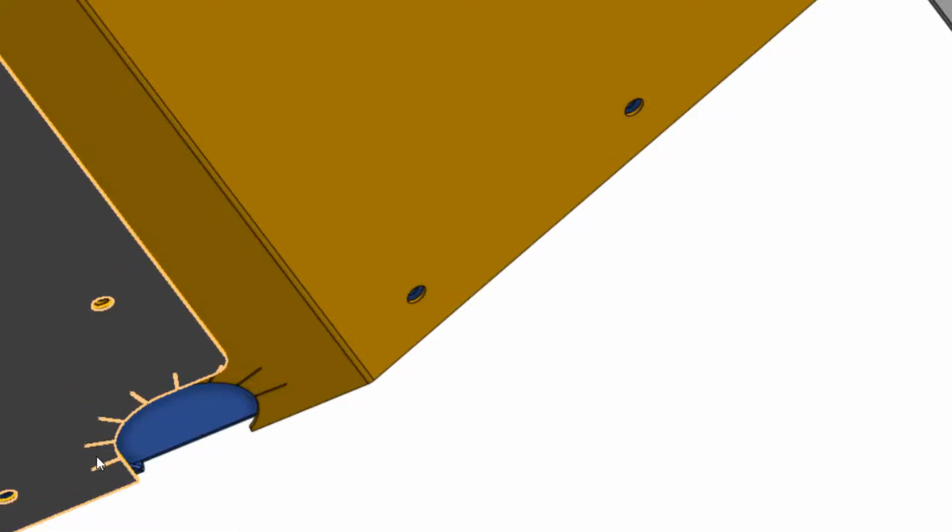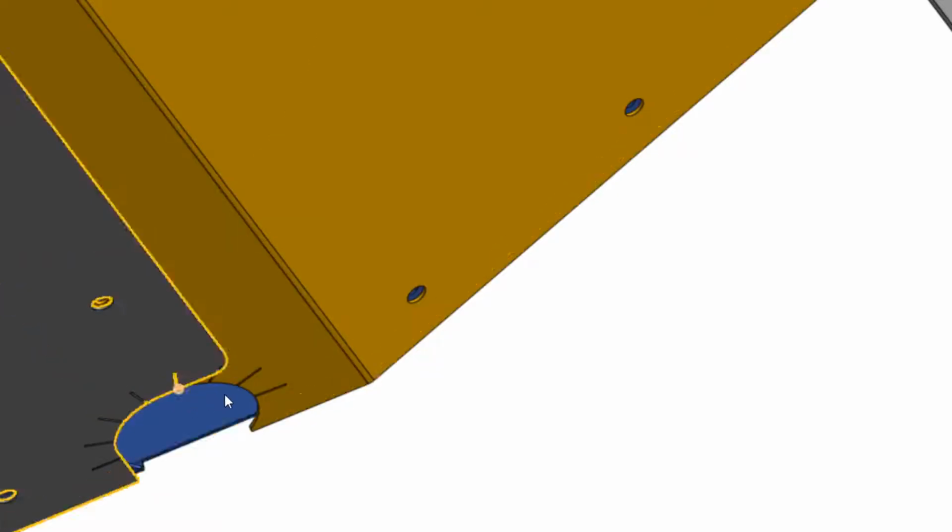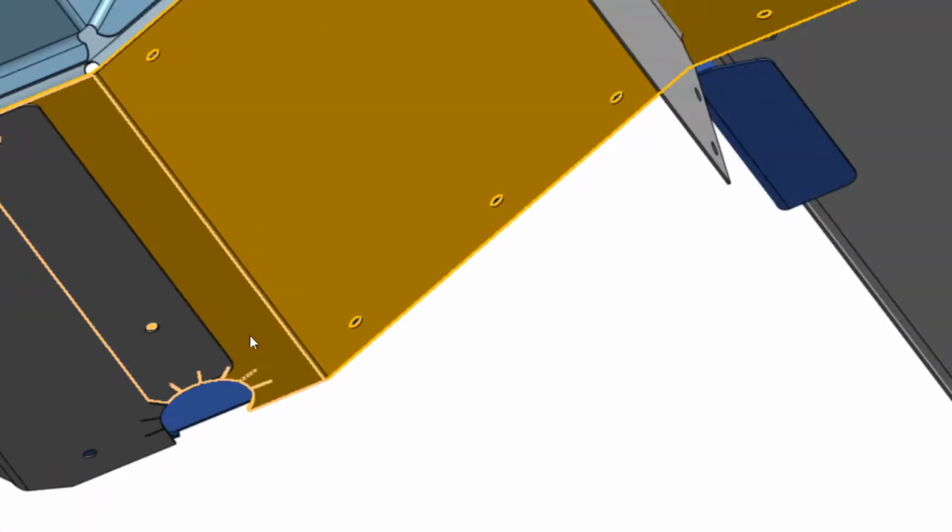You could even need to shift this hole if that pipe or the tube isn't exactly in the same place as it was on the machine that I measured for this. There seems to be some variation in those things occasionally. But make sure you've got some clearance. Later on you can tighten up the space around this with a little of that tape if you wish to.